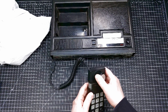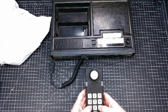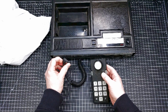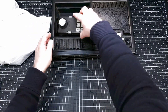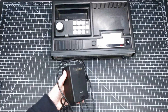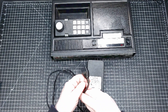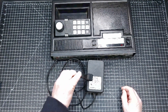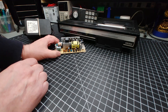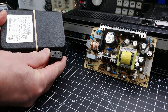Here is our single controller — a little bit dirty but looks to be in good shape otherwise. Now I just need a second controller. If anyone watching happens to have a spare controller floating around that they don't need, leave a comment below and I will get back to you. And this, I assume from the weight, is the original power supply, possibly faulty. Even if it is faulty, there's one part we can use in our replacement power supply — that would be the cable and connector, because this is an oddball connector. I have seen that you can 3D print replacements, but I don't have a 3D printer. So in an upcoming video we will look at replacing the original power supply with the new one, and reusing this very strange ColecoVision power connector.